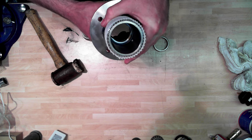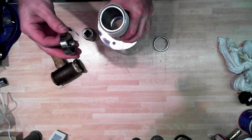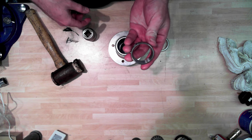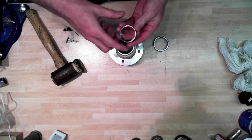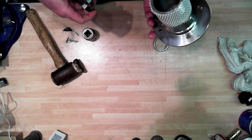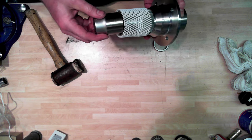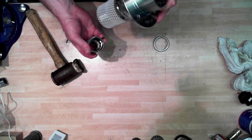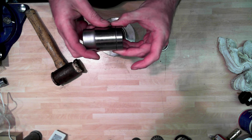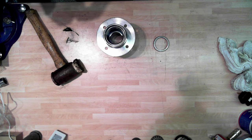You may be able to see down there - down that hole. We're going to put the other bearing race, which is this small size. It's going to go beveled side out this time because the bearing has got to drop down. The larger bearing goes in from this side, the smaller bearing goes in from this side, and that's going to drop down there with the bevel facing outwards. We're going to drive it home using this socket, which just happens to be the right size. We'll come back once I've done this.